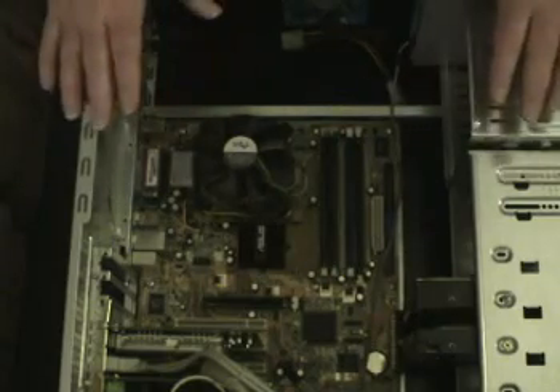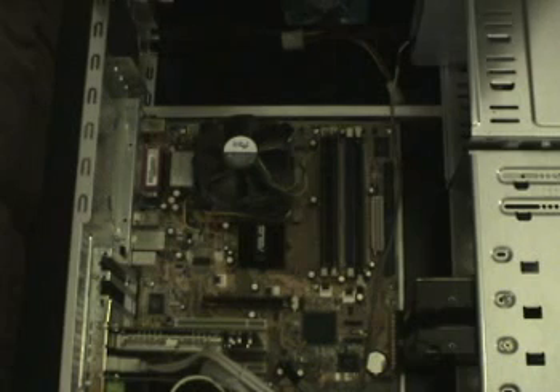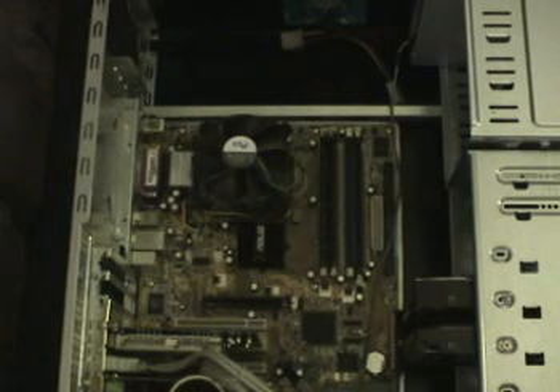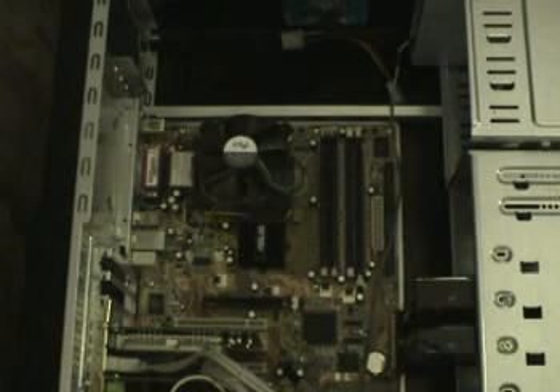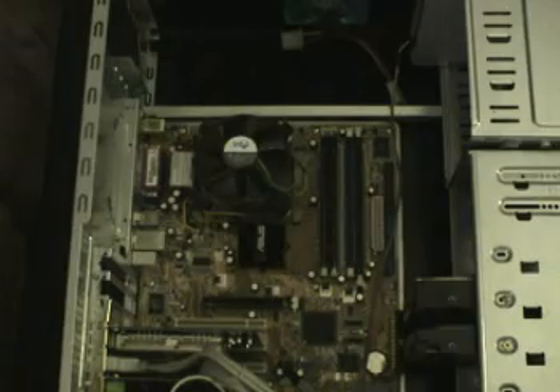When you're getting into all this, you're going to need a good power supply, as I've mentioned multiple times. Good power supplies are most of the time single-rail. Single-rail power supplies can create a lot of noise, so you have to get a high-quality one and check hardware reviews to make sure there's no noise on your audio channel — it can also interfere with USB connections. With a good power supply, the voltages are going to be more stable and won't sway much. Too much sway means too much or too little voltage, which can affect your RAM, CPU, Northbridge, hard drive — anything in the computer.